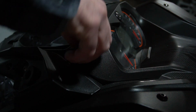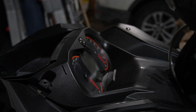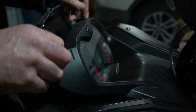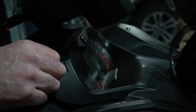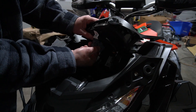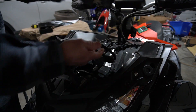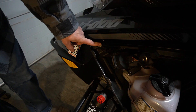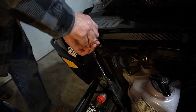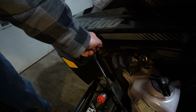I'm just going to do these by hand. This will pivot up like that, and then you can lift the glove box right out. We actually have to take the hood off, so we're going to unclip this and pull that apart. There's another connector in here — slide that out and then that'll come off. To take the hood off, there are two screws here and then two up by the handlebars — the ones with the washers. We need a Phillips screwdriver because we've got to loosen off the air box.